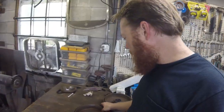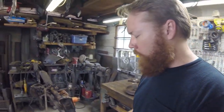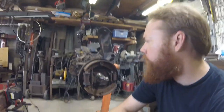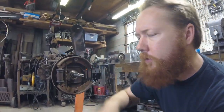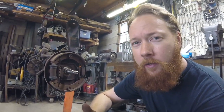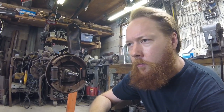I looked up the measurements and the wear limits for the drums, and these are just inside those wear limits. I'll go ahead and take these bearings out, clean them up, and replace the seals. I went ahead and sanded them down a little bit just to get some of the surface rust off and it feels nice and smooth. Everything else is going to be new or totally refurbished — I've got new hardware for the brakes, new wheel cylinders, new hard lines, new rubber lines, all springs, and these adjusters. I'm going to take the backing plates off and sandblast and paint them, so all of this will be fresh and new. I am sticking with drums mainly because I've got so many of those parts. Maybe someday I'll get a conversion kit, but I'm going to see how the brakes work. As I understand it, they're adequate as long as you keep up with them.